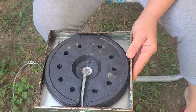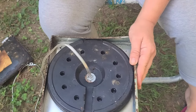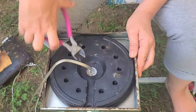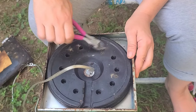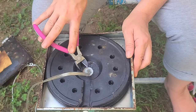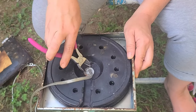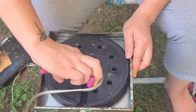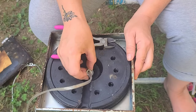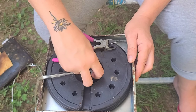Remove the bottom of the lamp — it's usually just a piece of felt. If your lamp is like mine, you have to pull the cord out of a little hole in the base. Then go ahead and unloosen the nut that holds the lamp together. Generally you want to do this with a pair of pliers. All I had were wire cutters, so we're just going with it. After you break it loose, which might take a couple of tries, especially if you're using wire cutters, you should be able to just take it apart with your fingers. You're going to be taking off a nut and a washer, and you need to set both of these aside for later because you are definitely going to need those.